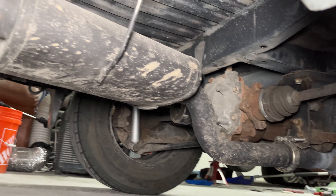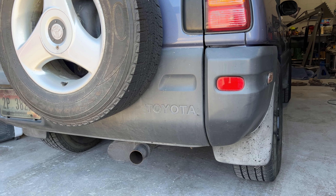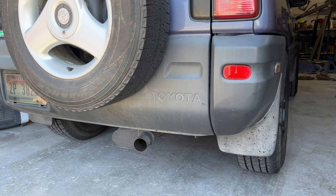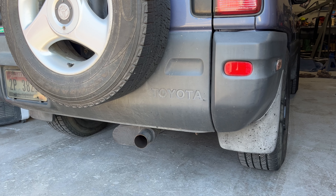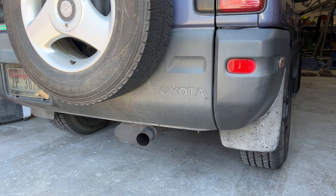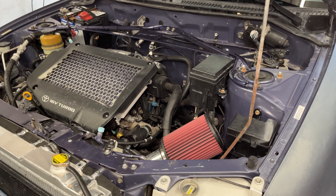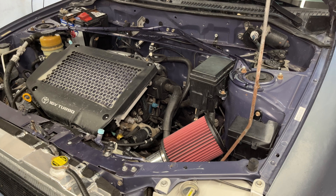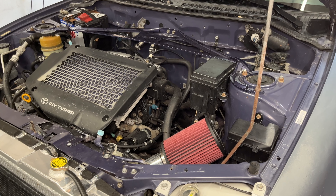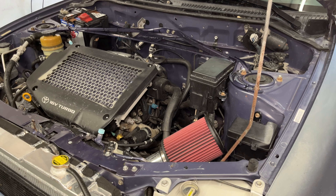Here's how it looks installed in the car. The downpipe is 3 inches in diameter and made of stainless steel. There is a high-flow catalytic converter right after the subframe that tapers down to a 2.5-inch pipe going to the back of the car. Finally, there's a Flowmaster muffler back here. How does it sound? Let's find out. You get a bit more induction noise up front, with some cool turbo noises, of course.